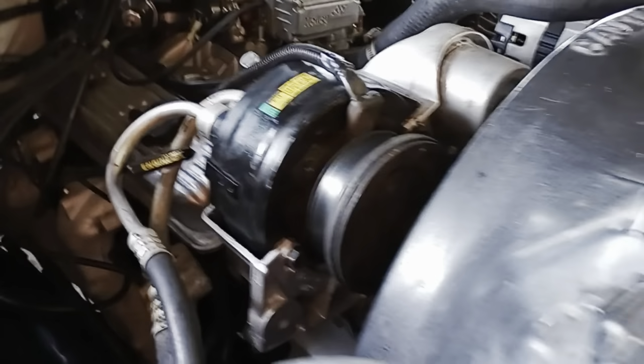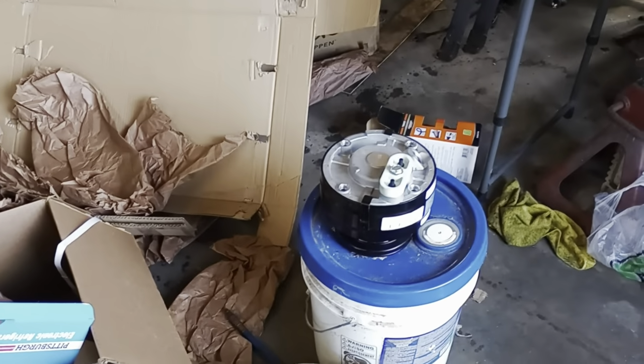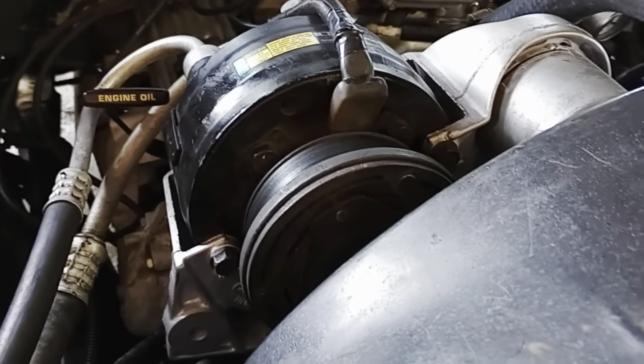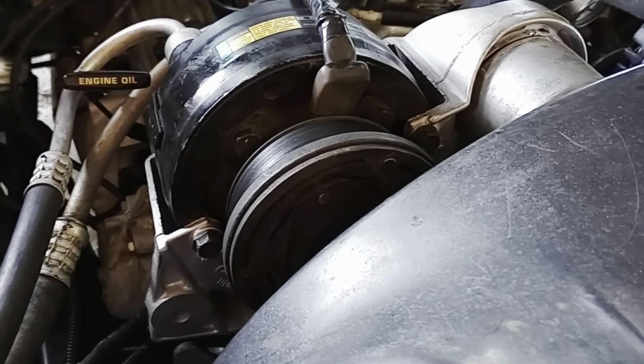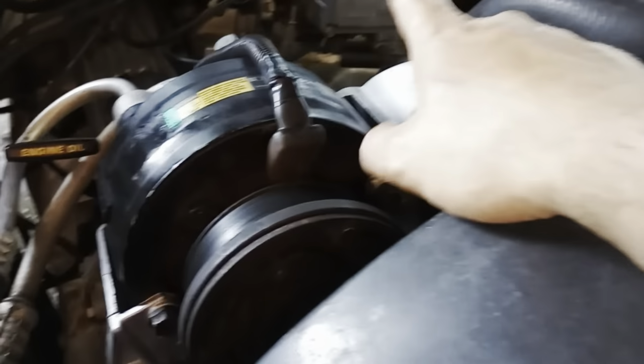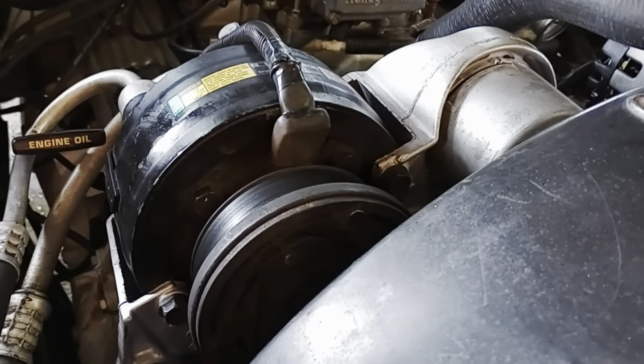and smoking. So I have the old compressor, pardon the mess, and the new compressor sitting right there. It's about to get shipped back. And that is the old one, but the old one is still working. Everything I've read up on these old GM compressors, I think R4 or 4R is what they're called, the pancake style compressors, is that they're kind of hard to kill. And this one proved it. The AC is working flawlessly with this one. So save yourself the money and try to use yours.